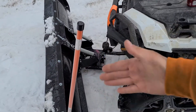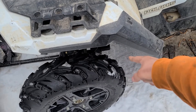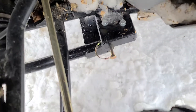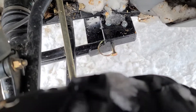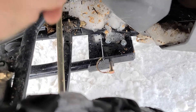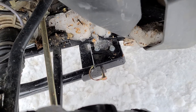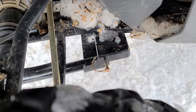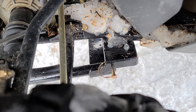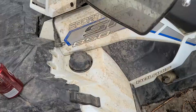The push tube was swinging back and forth, and that connects back here. I had a D-ring pin kit with different sizes. I took the original pin out and it had a lot of slop in the hole, so I took the biggest one I had in the kit and put it in. It's just a hair on the sloppy side, but it's infinitely better than what came with the plow and took up a lot of the slop.